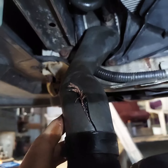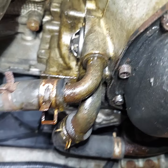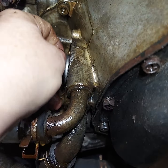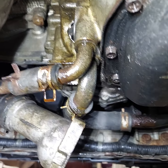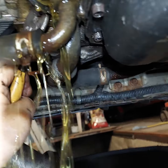There's your thermostat up in there, and you can see where the radiator hose blew out — that's why I'm replacing it. I'm replacing the thermostat because the customer wanted me to; there's not really any other particular reason. Let's reach up there with the pair of pliers — it's just kind of stuck in there. There we go.